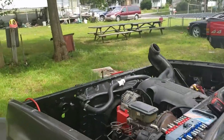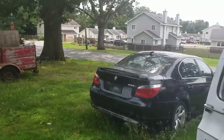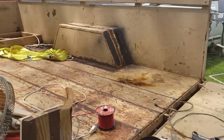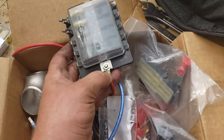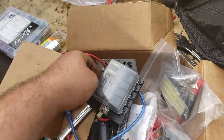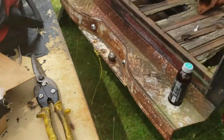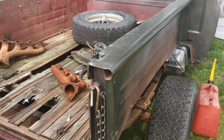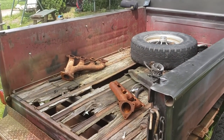My little fuse block — this thing from Online LED Store — I'll bring a 10 gauge feed wire from that junction block into here. This will run the key-on hot to my ECM as well as my brake lights. That's all I'm going to wire at the moment. The fuel pump and the fan relay are handled by the harness from Jason Richard, and my truck's not naturally aspirated gas either, so that's what I'm working on.